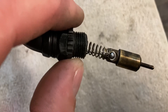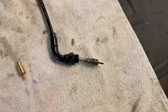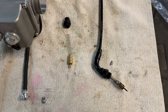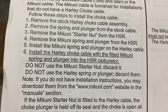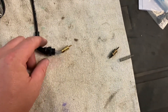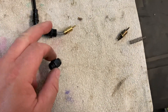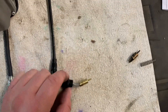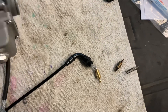I don't know how well you can see that, but you can see the slit where, once you move it out, you can take it out. I'm going to need both hands to do this so I'm not going to video it, but I think you've got the gist. If anyone has questions, feel free to shoot me a message and I'll try and help. I need to make a correction here - this is the nut off the Mikuni one, and that hole is too small for the Harley part. When I read the instructions properly, it actually says to keep the Harley one for this. So now to screw it onto the Mikuni carb and push it into place.